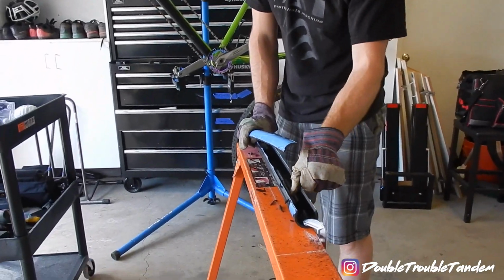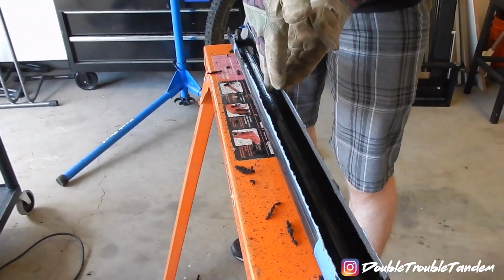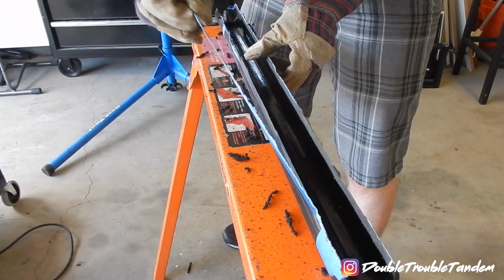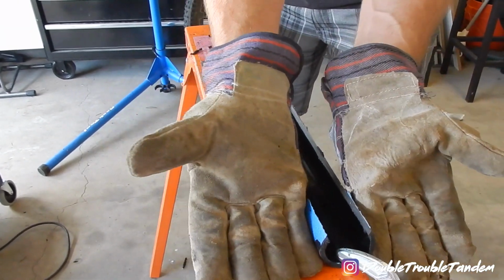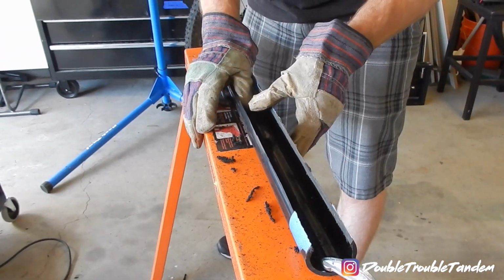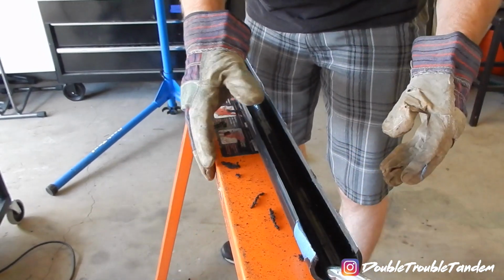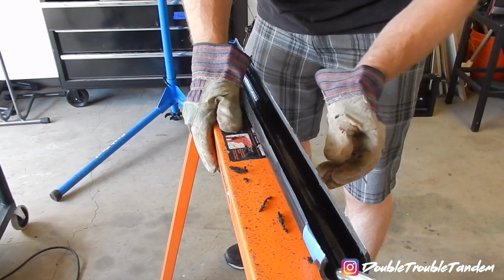So now we've got a nice open piece of pipe with, like I said, steep angles in here, steep angles in here. The next two steps we're going to do are to make it get on a little bit easier. We're going to cut a chamfer going this direction on at least one side, which will help us get a starter to help spread this pipe around the bike. And then also we're going to sand this top edge, because this top edge is extremely sharp.